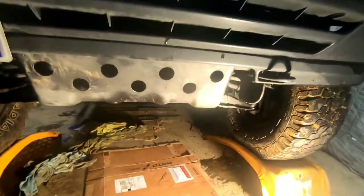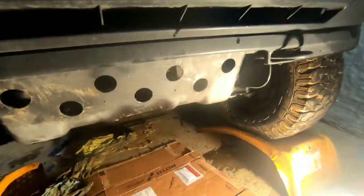This hole here — the dent is already all the way back as far as it'll go, so we've got to wiggle that thing up a little bit so we can get that in there. Push this side up, try to find that hole. That back bottom one — I just had to use two hands to get to it. That's why I mentioned you've got to leave these ones here loose, and then once you get those ones tightened up down there, come back up and tighten up the rest of the stuff. This one's got that little plastic guard in the way — I'll move that and get this done.